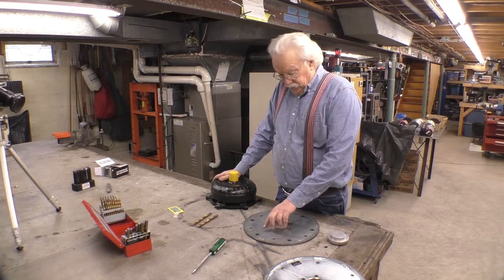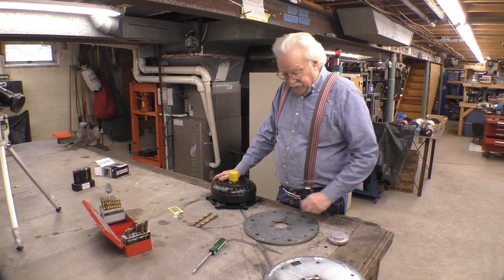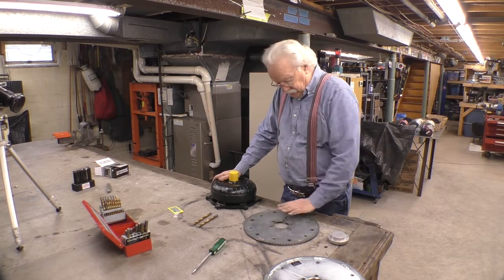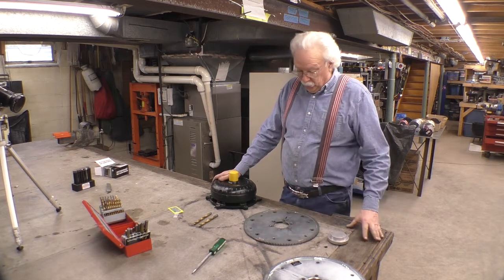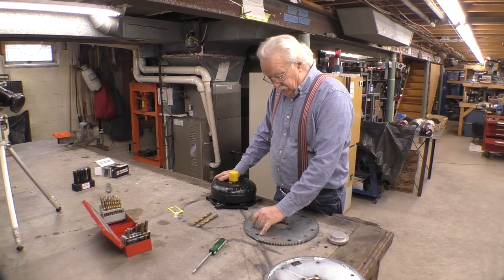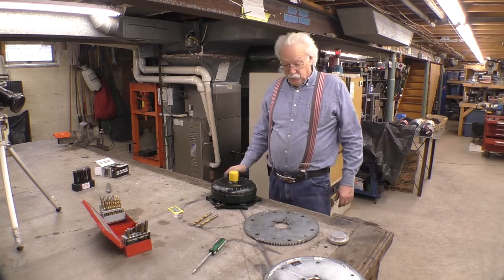These holes, here's one problem. These holes should be equal distance apart, and they're not, because they're a neutrally balanced plate. Although it really doesn't make any difference because there's 6 holes, so the material you remove balances the plate out. But you'd want to be, it doesn't take much to get halfway between those holes. So we can do that, and we're going to do that.